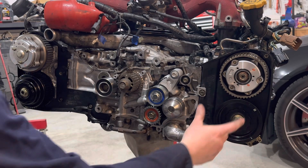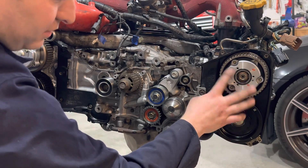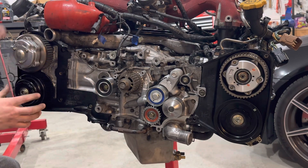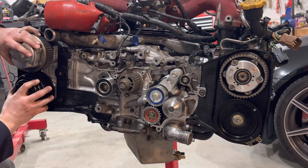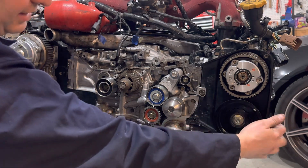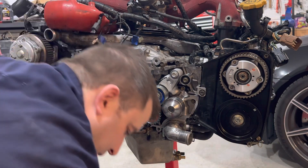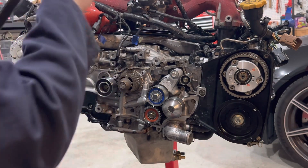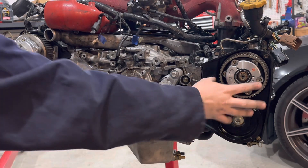These double lines are not lined up yet — they're kind of loaded. I'll show you how to set those with 10 millimeter hex sockets. These are the passenger cams and they rotate freely. Line up your double marks here. I have the timing belt guards torqued down from where I had it set before. These cam pulleys don't have a lip, so you can slip the timing belt underneath.